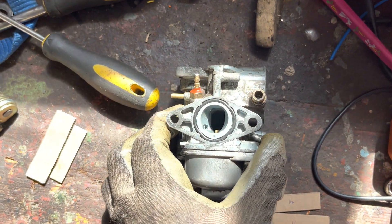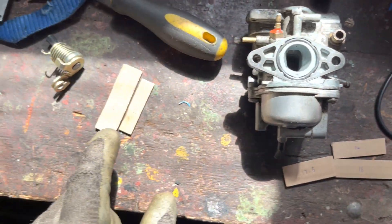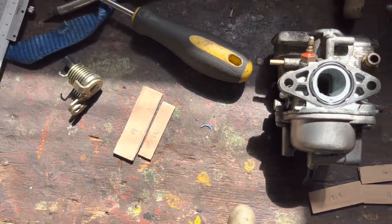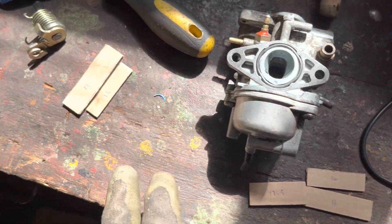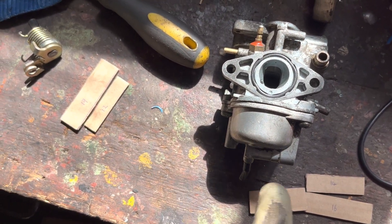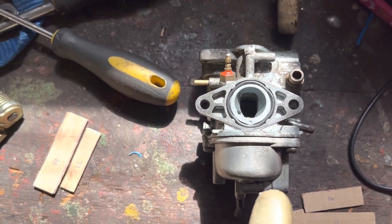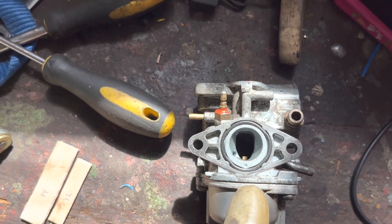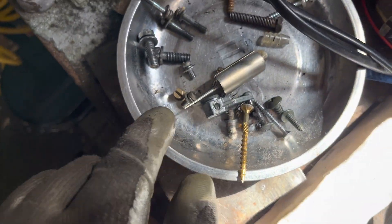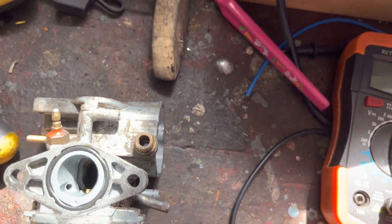So how do we work this out, especially with an oval bore? What you do is grab some bits of cardboard and cut them to different sizes. I've done a load of quite common sizes here: 19mm, 17.5mm, 16mm, 14mm, and 12mm. We're going to take two measurements. The first measurement is going to be from top to bottom, and you'll want to take the slider and the pin out first so you can drop things in there without anything getting in the way.